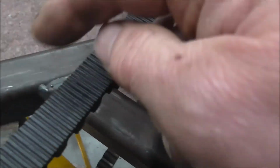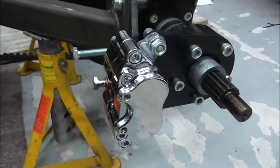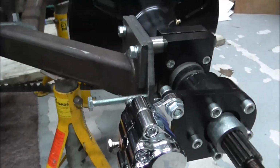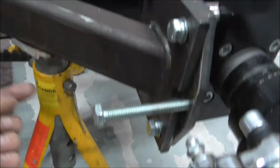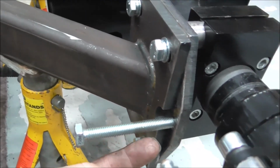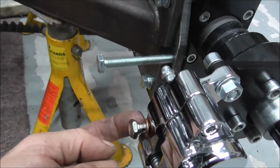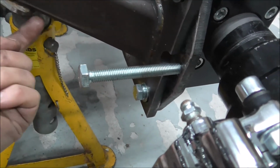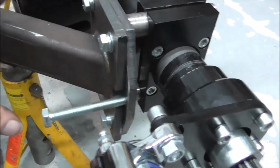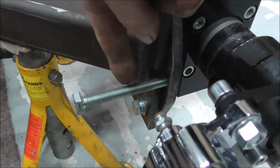across underneath, clamped on properly, and I've repositioned this rear caliper as well, and I'm going to put the calipers there. Reason being, as I say, I can bring the line underneath here, bring it out and across. So basically I can come straight off the caliper and under there. All that moves, it would be like one piece in a sense. And then basically it leaves me with my handbrake cable to come off.